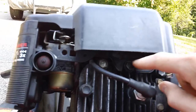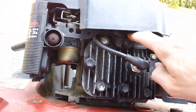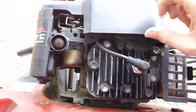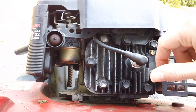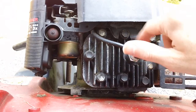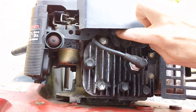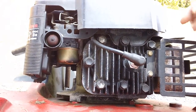Your identification tag will be right underneath here. You've got your cylinder head here. Your identification tag will be right underneath the shroud, directly above the three bolts on the cylinder head. It's on this plastic cover for the engine. So if you're looking for your identification tag, it'll be directly underneath the shroud and on top of the cylinder head — just look straight up and it'll be about a half inch above the three bolts. You'll need a brush to wipe it off. That's where your tag will be on the older style engines.